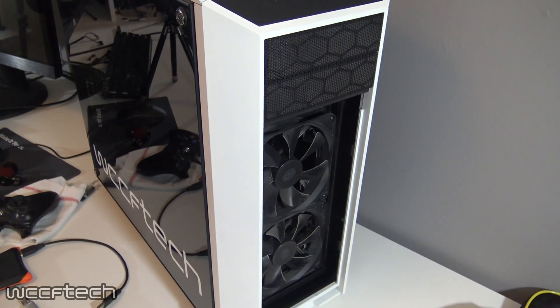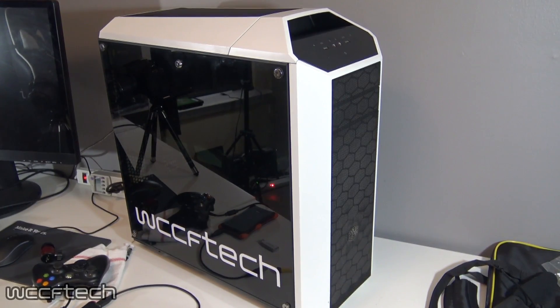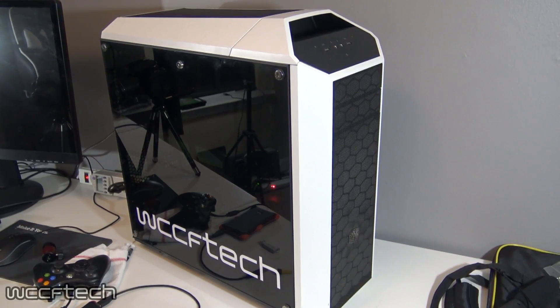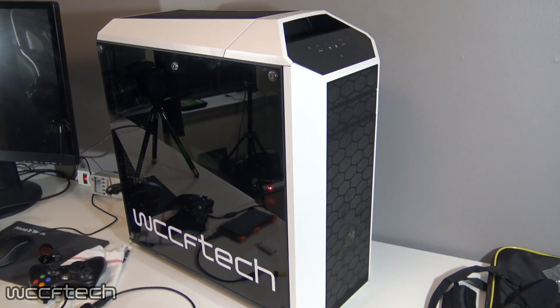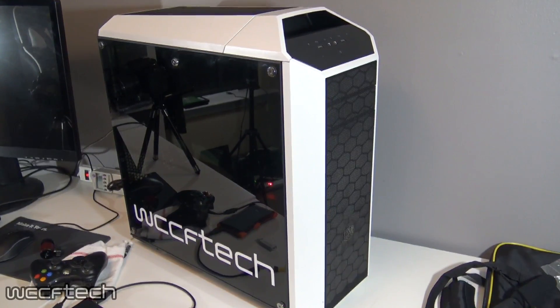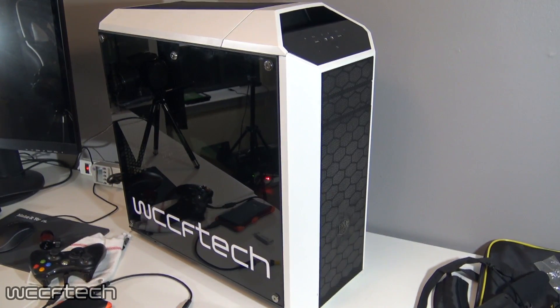This was to represent all coolers in a more realistic working environment with the ambient temperature controlled to 22°C. For stock and overclocked stress tests, we used the ASUS RealBench H.264 video encoding and heavy multitasking looping for around half an hour.